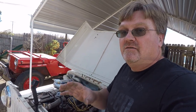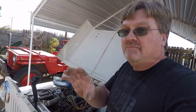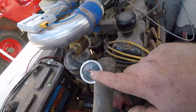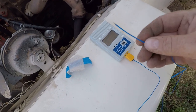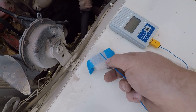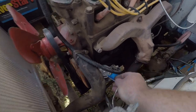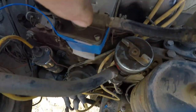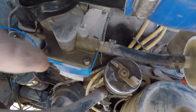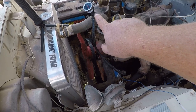There are really three things I've got to check. I'm going to need to check the fuel pressure just to see where we're at, and then there are two spots I'm suspicious of — the carb and the fuel pump — as potential hot spots. I've added a gauge in line for pressure so I can actually see what it is. And I've got these digital thermometers with a thermocouple end — I'm going to put that on some foam to insulate it and stick it on potential hot spots like this fuel pump. I also attached another one to the side of the carburetor so we can monitor both temperatures simultaneously.